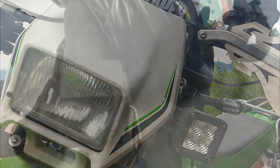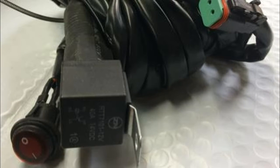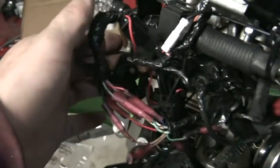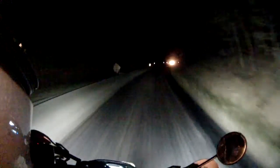As far as wiring goes, I recommend installing a relay, as this allows the device to be wired to the key switch without the chance of being underpowered. Many people choose to wire aux lights into their brights, so that they will turn on and off with the flip of the high beam switch. This is a good idea, since flipping two switches gets really annoying.